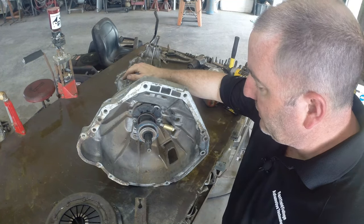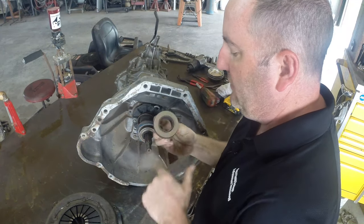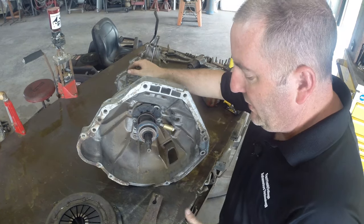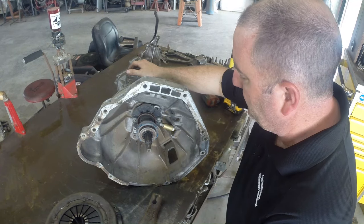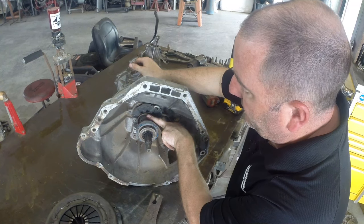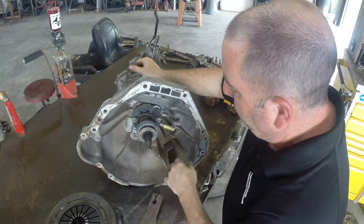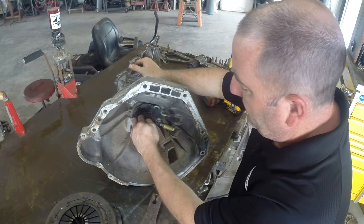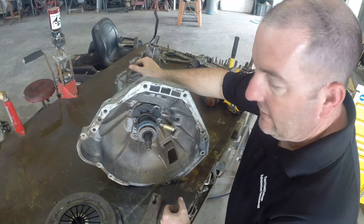One of the problems we run into with this is if your bearing is bad and making noise — like this one was probably pretty noisy. In order to replace it, you've got to pull the transmission out. And if your hydraulics start to leak, which is not uncommon — this lives in a hot environment filled with abrasive caustic brake dust, which can eat the seals and piston on the slave and cause it to leak — transmission's got to come out to do that.